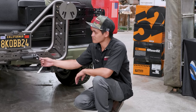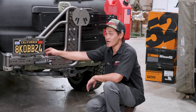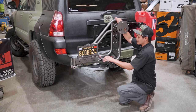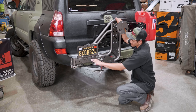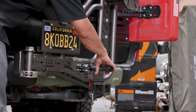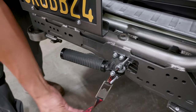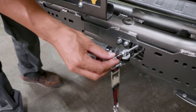You probably already noticed there's also a bottle opener. This stainless steel safety pin will keep your trail swing locked and safely in place even if the latch happens to pop open on the trail — so you can see this is completely loose and it's still not going anywhere. When you go to open the trail swing, it's always pin first: drop it closest to you, open, pull — now you're clear. That way this won't accidentally latch when you swing it open.